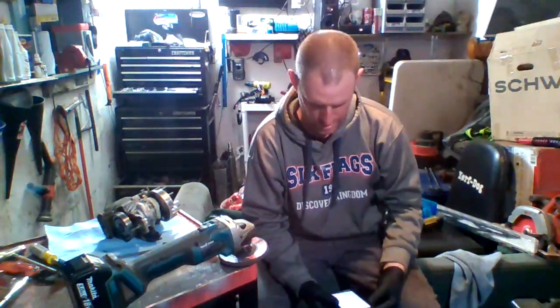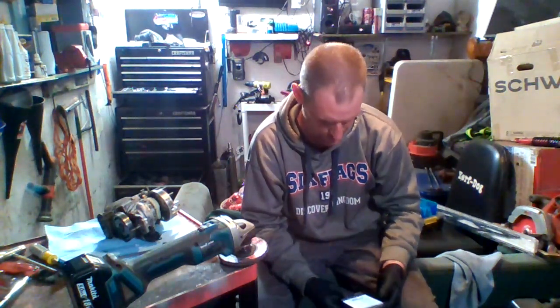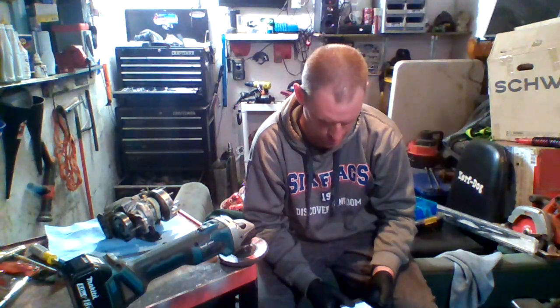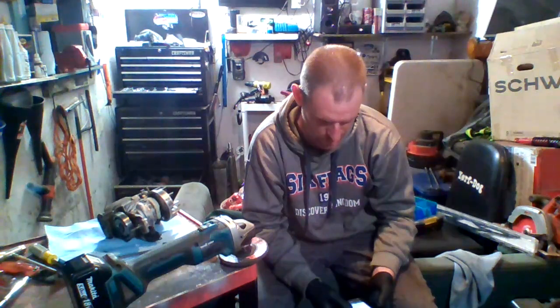Engine displacement is 1.78 cubic inch, 29.1 cc's. That's actually pretty impressive. Let's see if there's anything else in here worth noting for you. Cylinder bore is 1.375 inches, piston stroke 1.2 inches, thickness it doesn't show, cylinder type aluminum with chrome plated bore, intake method piston ported, manufacturer's advised horsepower not advertised, weight not advertised.